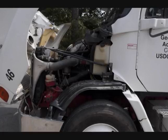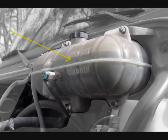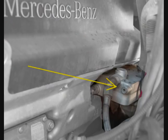Move to the left side of the engine compartment. Check the coolant level in the overflow tank — it should be between the fill and max lines, and hoses and connections should not be leaking or show signs of damage. Check the air compressor to ensure it is operating properly, mounted securely, and not damaged or leaking. Make sure you tell the examiner that the air compressor is mechanically driven, not belt driven. Hoses and connections should not be leaking or show signs of damage.